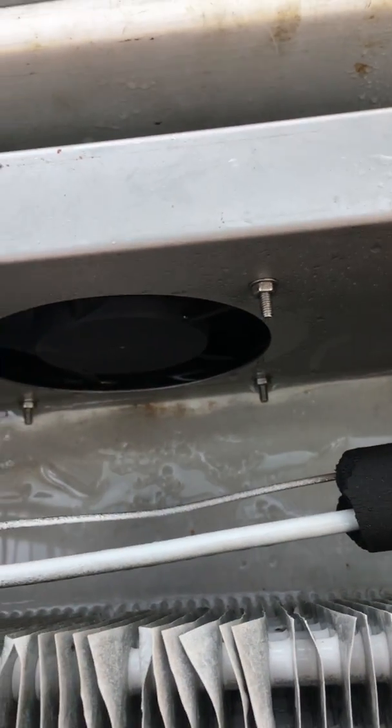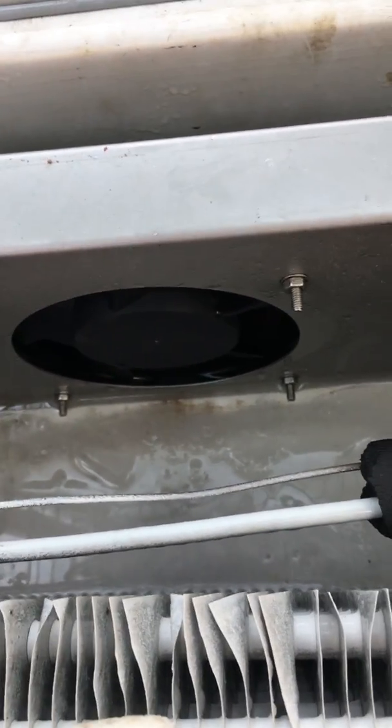What we can actually see here is that the fan is sitting in water. This here is ice — there's a large block of ice which has built up here. And what that ice is doing is stopping the fan turning around, slowing the fan down as it's trying to turn through the water.